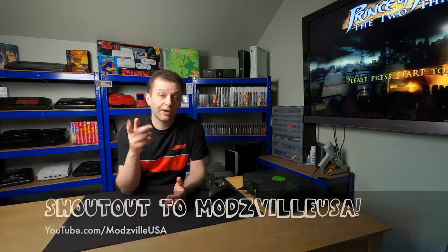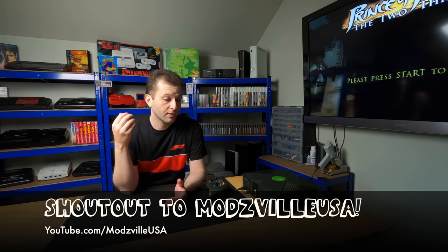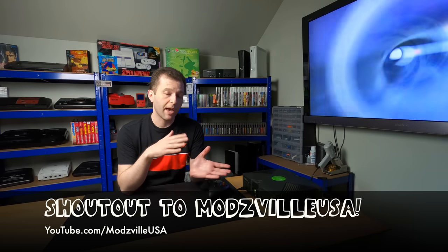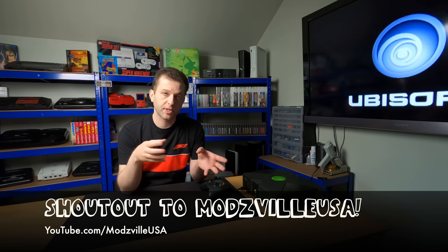In terms of this unit, I think I accomplished what I set out to do. We took a stock Xbox, put in a new clock cap, new thermals, refurbished the optical drive, installed a mod chip, flashed it with Cerbios, and I have the full library of games on a 3 terabyte hard disk. Shout out to Modsville USA. He's the one that brought this project to my attention, so this build turned out to be a lot cooler than the plans that I had for it originally, which was just maxing out the 2.2 terabytes that the older modchips and BIOSes support.